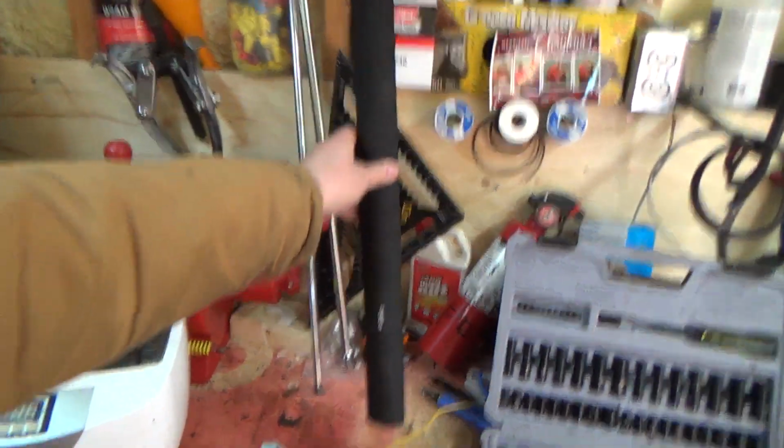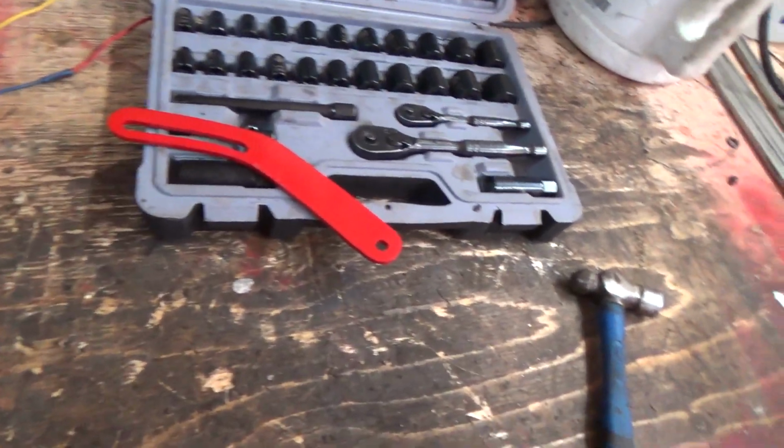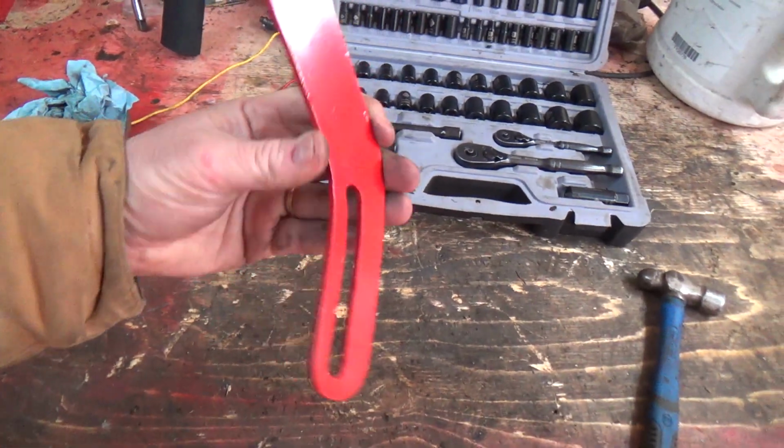Pretty good here. So, gonna work on the 800 a little bit today. Hopefully, I want to drain a bit of fluid out of the radiator because I want to change the rad hose. Hopefully, that's the same size. It should be pretty close. Should be is a big should be. But that and put that new temp gauge in. I want to pop the old one out, of course, too, and give it a test and make sure it's really dead. We got our new bracket painted up, ready to rock.